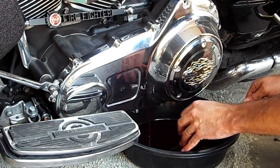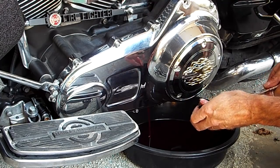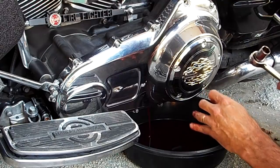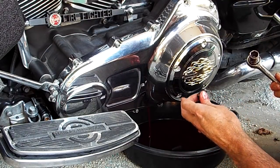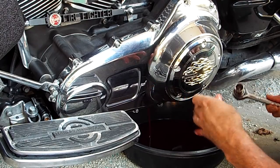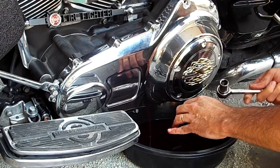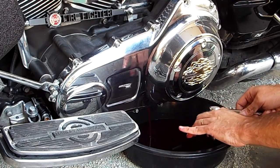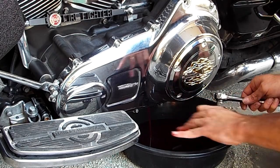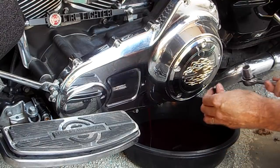So I made some changes, and I added one of the thin concave spring washers to this pack of spring washers, and I'll show you that once we get it apart. I had to do some welding, a little bit of tack welding in four different places around the perimeter to keep it from sliding off to one side and stay relative to the other factory spring washers.